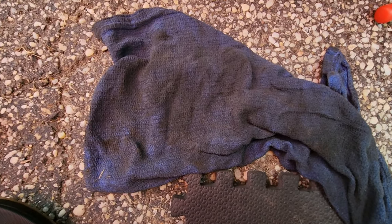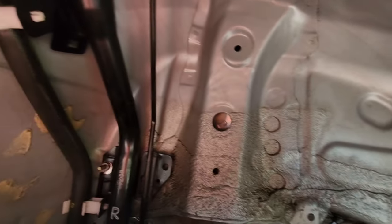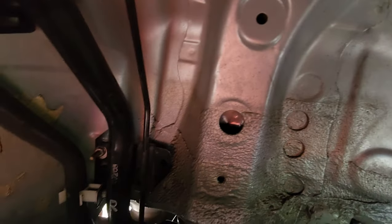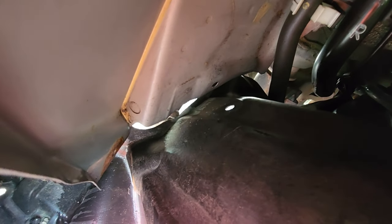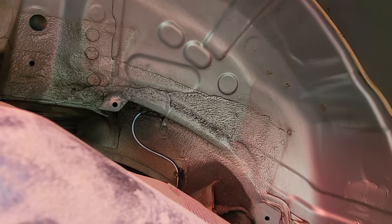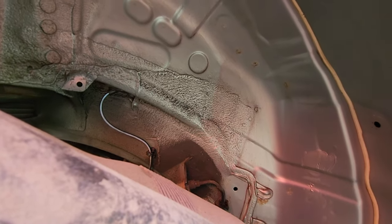As I've said before, if what you do results in dirt then you are not wasting your time. You really want to focus on the bottoms — all the way around the frame and trim — because that's where water will sit, accumulate, and oxidize. Hit that pretty heavy, and then everything else. We're going to make sure we get the outside edge of that well too. I did the other side before this video so I'm familiar with how this sprays. Don't be wearing a watch — take your watch off. I'm maybe six inches away.